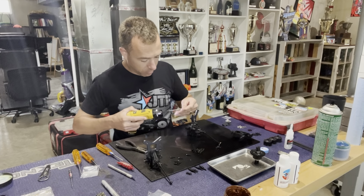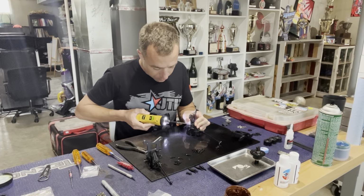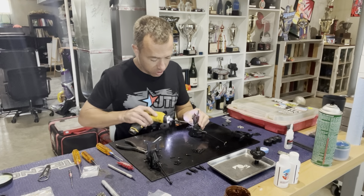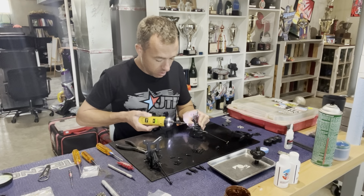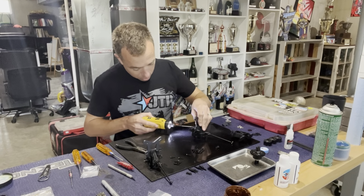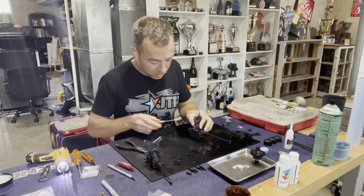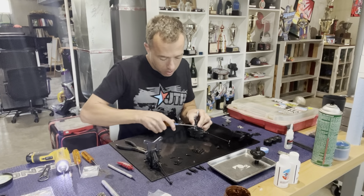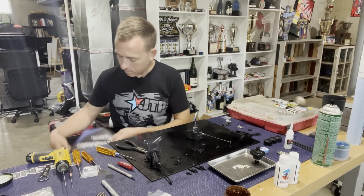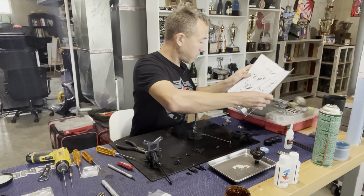And the way that I run my wing mount, I can go ahead and put these upper screws in because I run my wing mount raised up just one position, which is the +7 height. I run the HB wing. If you run that wing, I would recommend going to the +7 height. If you run the stock Tekno wing, I would recommend just going in the standard stock location, which, let me bust out the manual to make sure that's accurate. It might have you put it up.